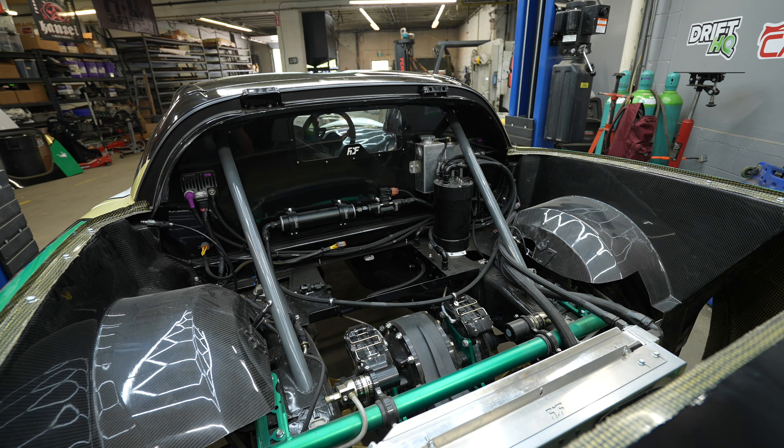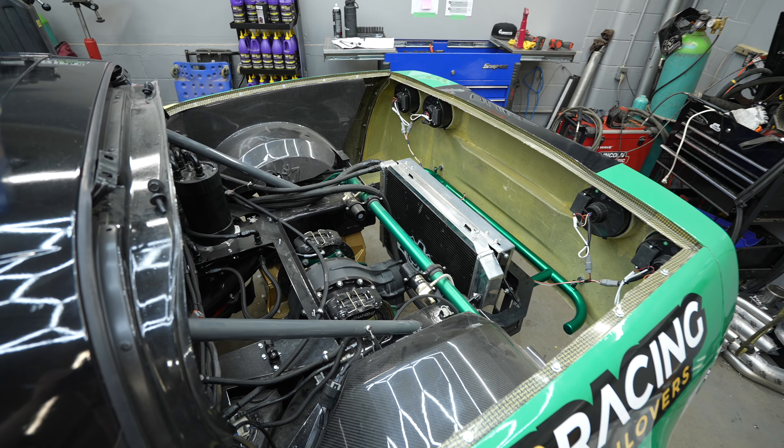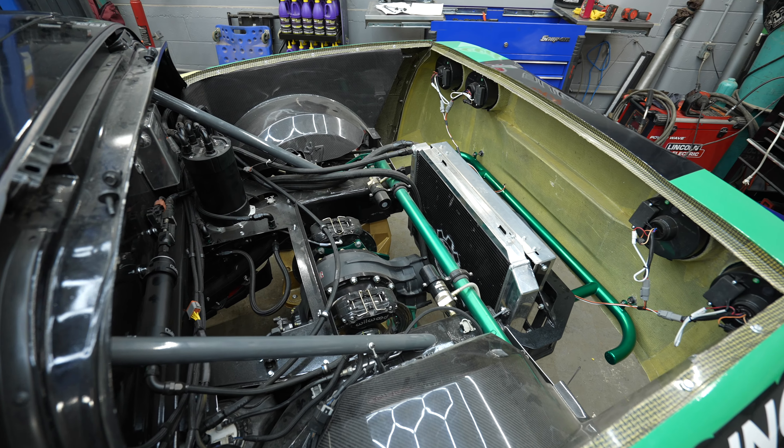Another downside is that mounting the brakes within the chassis isn't really that easy to do, especially if you have a unibody with a subframe. It was really only possible on the Corvette and maybe a few other types of chassis — otherwise you'd have to modify the subframe and cut a bunch of pieces out of it. On a 240 for example, it's absolutely not possible without heavily modifying the subframe, and that's the reason why nobody ever actually does it for drifting.